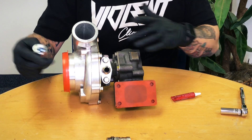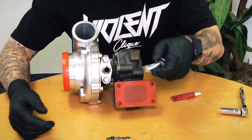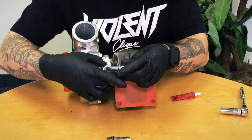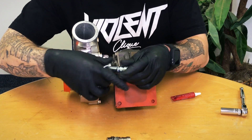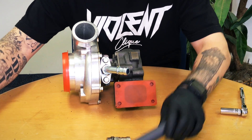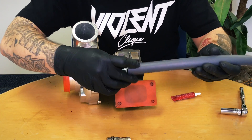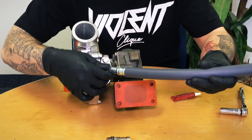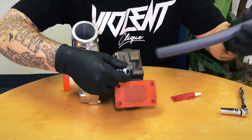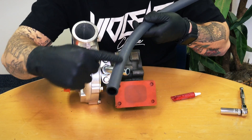Same thing on the opposite side — we've got a flare fitting setup, so no need for thread tape on this. Torque it down, ready to go. Now this kit came with some really nice oil-resistant hose and some pretty good clamps. This is going to come on here, and as this oil drains out through gravity it goes back to the oil pan down this hose.